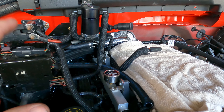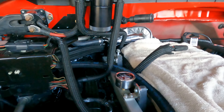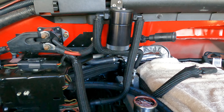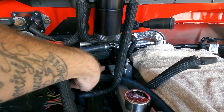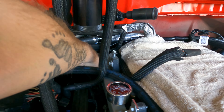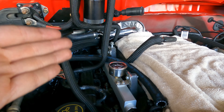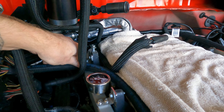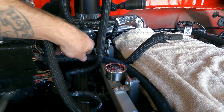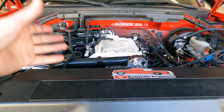At the very end I'll go over all the routing again in case you guys got a little confused. I did want to take this line and go all the way back around the coolant crossover, but in doing so you give yourself almost no room to get to that back plug. I actually had it mocked up that way — it looked really nice — but then you can't get your hand back there to do that plug. So you have to think about all the stuff you're going to have to do down the road: plugs, coils, what's it blocking, what's it running over. That's why I ran kind of short with this one. It's not really in the way and I can move it — got some movability there. So we're going to go ahead and build these last couple of hoses and finish up this install.